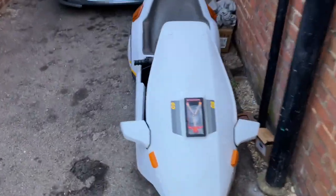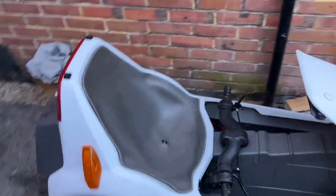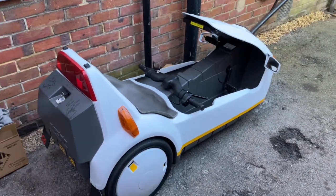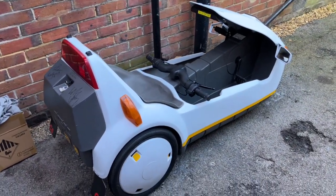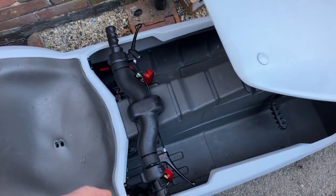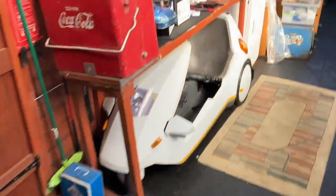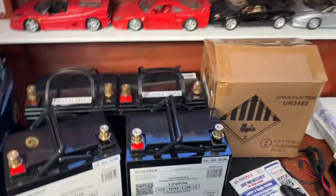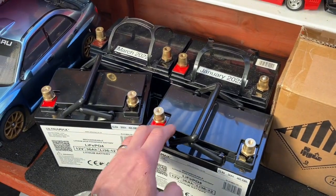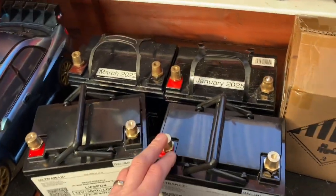This one is the big dog — the 24V Sinclair, the fast one. This is the one that Astronaut Sir Tim Peake rode on television, and yeah, that's now 24V. Running two AGM heavy lead acid batteries in there makes the whole thing super super heavy. It tops out about 23–24mph, but with these lithiums I should get an extra mile per hour because of the lightweight aspect and how efficient they are.